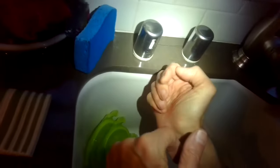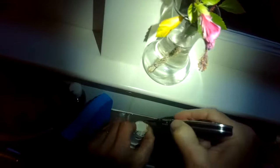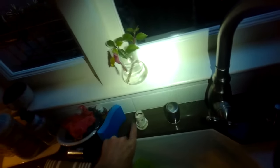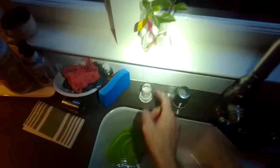This is something you can also check while you're working on your dishwasher — look at the air gap to make sure nothing is clogged there. I remove the top and then press in on these tabs to remove the plastic piece on top, to see if something is caught in the drain system. This is just something to do anytime you work on your dishwasher to make sure the drain system is working well. I look in there — the small tube in the middle looks really good, nothing seems to be caught in there. If you did see something you could just pull it out, throw it in the sink, and your dishwasher will drain really well.